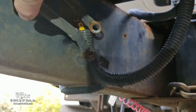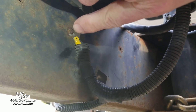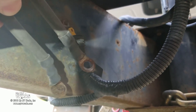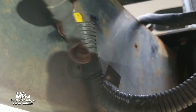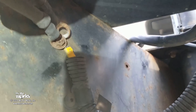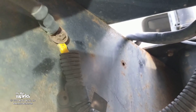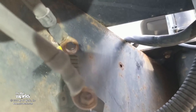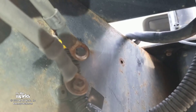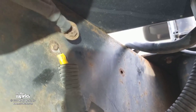Look at what we found underneath. That part right there — I put a screw in and it rusted off. These are my two leads. See how the bolt head is still on this one but not on that one. We need to put these back to frame and then everything will work again. I hear arcing — sparky! There's our problem. Go check yours — make sure that your ground is bonded well to your frame. We're going to fix this real quick and wrap up the video with a correct voltage reading.